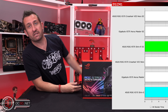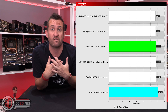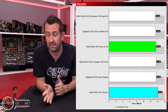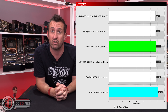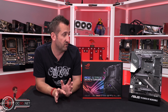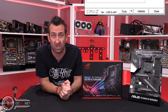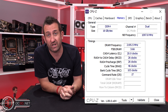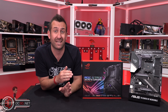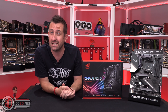Performance, as the graphs show, has done really well. Yes, it's a little more money than we've been used to, but that's because of the way AMD implemented PCI Express 4. If you're arguing about pricing, you might wonder whether AMD should have stuck with PCIe 3. The board overclocked really well — we did get the memory to 4,400 MHz stable. With the 3900X the best I managed was 4,533 MHz, but at that speed it wasn't 100% stable for intensive tasks like Blender.